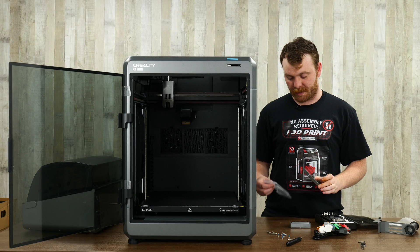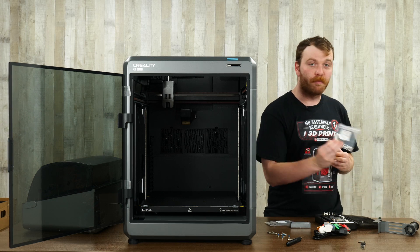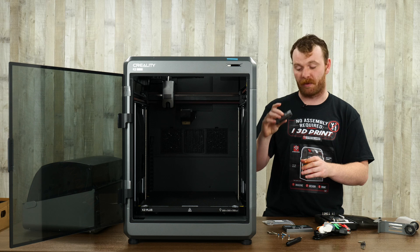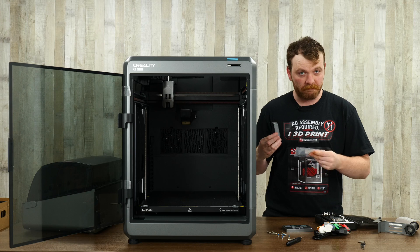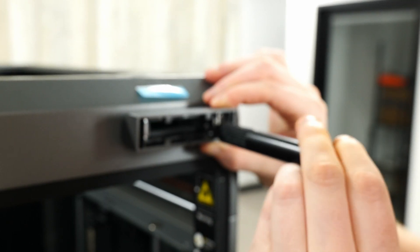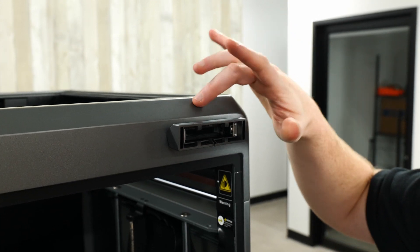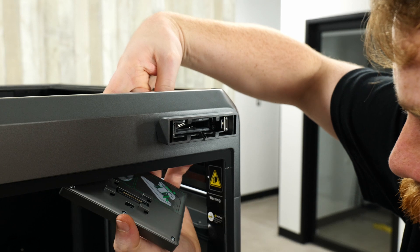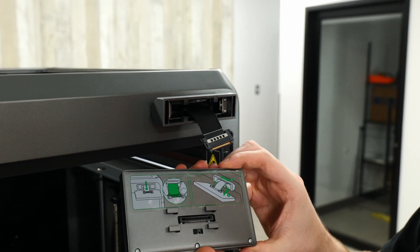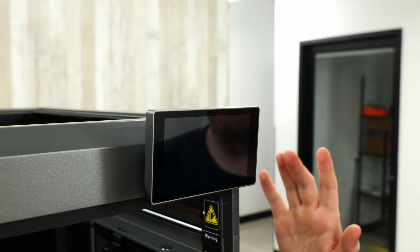Next, we're going to install our screen. There are two bags of screws — one says 'screen base,' one says 'buffer screw.' It's pretty obvious which one they want you to use. The screen component has four screws. Place it in and tighten — I'm not going to fully tighten, just enough so it won't move. Once our four screws are in and the tape is removed from up top, take the cable and slowly angle it through. The connector can only go in one way, and once you hear the click, slowly back it up just a slight bit and move it to the side. Once you hear that click, your screen is installed.